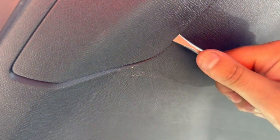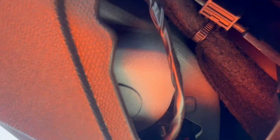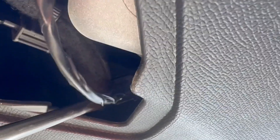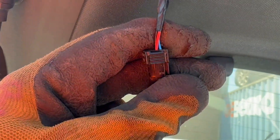Now for the taillight on the tailgate. On the tailgate, there will be little covers. Remove this cover and there will be another 10mm nut which you can remove with a 10mm socket, and then it will come off by hand quite easily. You will also need to unplug the taillight on the tailgate from here — that is the plug. Then the same idea with a plastic tool from the outside, you will need to just remove the taillight.